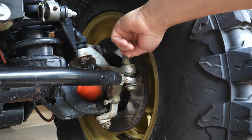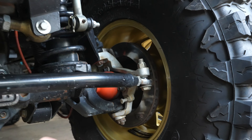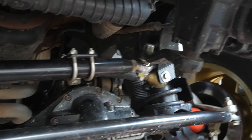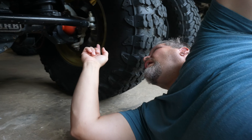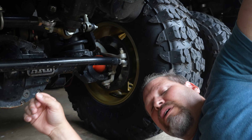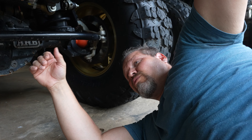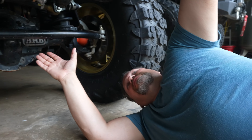This is the Steinjager steering. First off, you're going to have to drill your spindles out — those are half-inch bolts. You'll have to drill out your pitman arm up here. I think it came with the half-inch drill bit. Any 18-volt drill or quarter-inch drill will work. I was surprised how easy these spindles drilled, so don't get hung up on that. I think Steinjager sold the drill bit with it, but either way it goes through real fast.